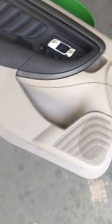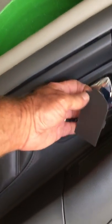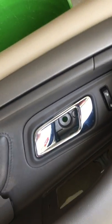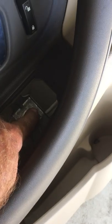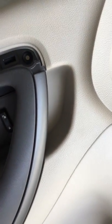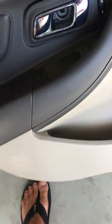I know there's some videos out there on how to remove the door panels. Basically, the panel has three screws that you want to remove. To get the switch out, you just put a screwdriver in here and pop it out. Behind the door lever here is a little panel that goes right in there — if you grab it from the back side with a hook or something, it'll pop right out. There's a 10mm bolt that pulls out of there, and another 10mm that's underneath the door panel. This trim has to come off — do it from the back and pull it out because there's a tab there. There's a Phillips screw, I believe an 8mm, that goes in there. Take that out and the rest of it is just push pins on the back of the door that pop out, so they're not too difficult to get off.